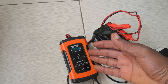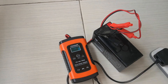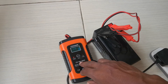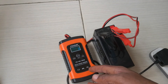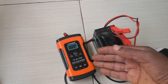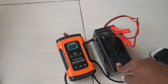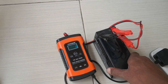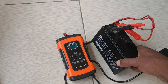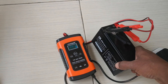Some misconceptions and common errors: you can connect this to a sulfated battery and it tells you the battery is full — how to handle that is simply to use the repair function. Also, there's a limitation on minimum voltage: if your battery is less than 8 volts, this charger will not be able to charge it. The good thing about this charger is that it's very affordable and it works. It features overheat, overcharge, and short circuit protection, so you're not going to overcharge your battery even if you leave it overnight. I love the pulse repair function — I once had the battery in my power generator run flat and sit flat for a prolonged period. When I called the technician he was certain I'd need a new battery, but I hooked it up to this and after desulfating, the battery came back to life. I'm still using it — it's been over a year since that happened. So it really works.